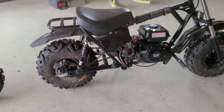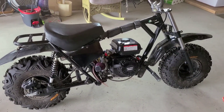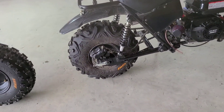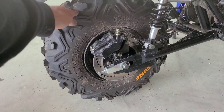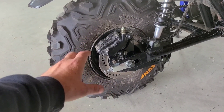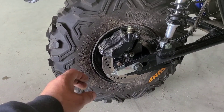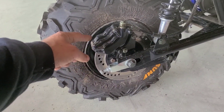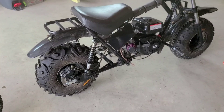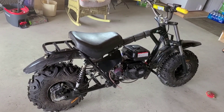One of the big issues I'm having is sort of self-created — that's with the Wildcat 223 and these big six-ply Sun F tires. We have a lot more rotation, a lot more force and friction being acted on things, including our brake caliper. Whether it's the caliper itself or the pads, she heats right up after about eight good roundabouts and they pretty much fade to nothing. So that can get a little bit hairy.